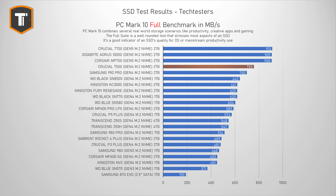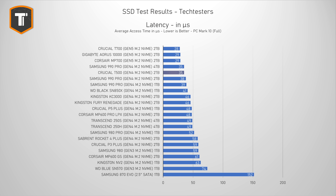Full PCMark 10 Suite is a test that imitates a more serious, more intense, and more constant use of your system. This is a great benchmark for anyone looking for a new main drive or for anyone that needs to run applications that can be very heavy on the SSD, like editing videos. And the T500 does great here — it is ahead of the 990 Pro by a decent margin, and it is comfortably ahead of every other Gen 4 SSD in the list, including excellent options like the SN850X, the Fury Renegade, KC3000, and so on. The result is very similar if we look at the latency as well — Gen 5 SSDs are a bit faster, but the T500 is ahead of all Gen 4 drives.